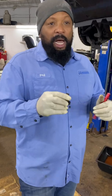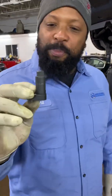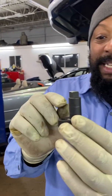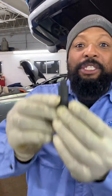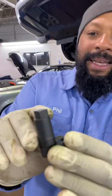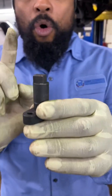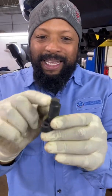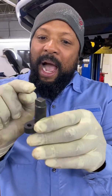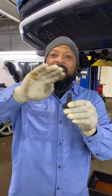The first thing you're going to need — vehicle up in the air — you're going to need the tool. It's a special tool that you take out the crank position sensor, and this slides into the bell housing. Once you do that, if you take a look right here — see that? There's only one spot on the flywheel that this square peg goes into. How you know it goes into it is that that's when the engine is at top dead center.